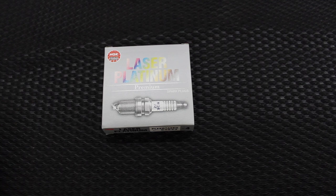This is a service that you should be doing at 60,000 miles per my owner's manual. I've heard online anywhere from 40 to 60,000 miles for these particular plugs on these particular TSI engines — this is the 1.8 TSI Gen 3 engine. A lot of the Volkswagens of this era have the very same engine or a very similar related one, like the 2-liter turbo engine.